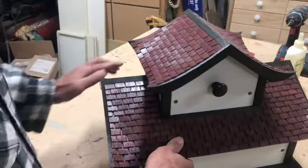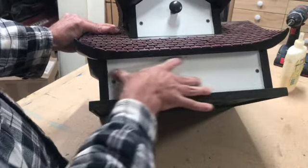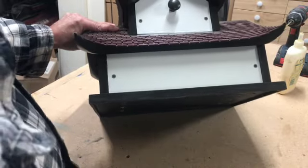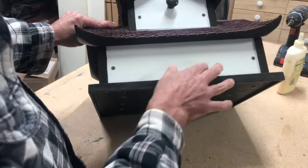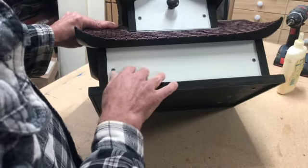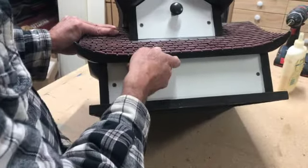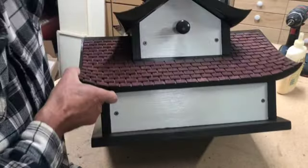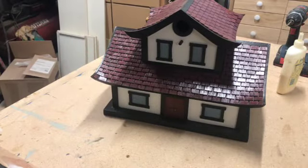If you look at this on the back side of this unit, these 2 screws, I pull those out. This whole wall just slides out and we can access the 2 chambers inside here to clean them out, which should happen probably once a year. And then this panel up here, 2 screws there, this thing lifts off, okay? So you can access it from the back. The front, those panels don't come off.